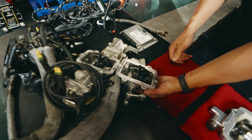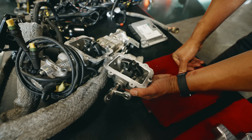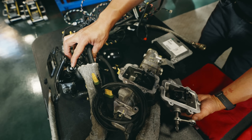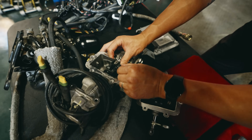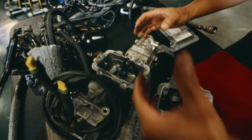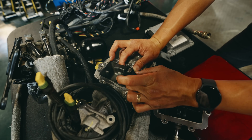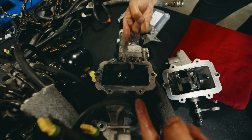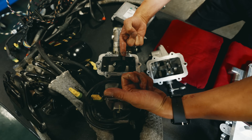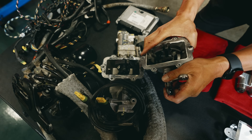So the F1 system — essentially same thing. Nothing inside the gearbox changes when you're doing a conversion from F1 to manual. What happens here is you have a bunch of solenoid valves that are controlling fluid flow. You have fluid flow that can change this. This one is a lot tougher to move, but it essentially pressurizes the system, balances the fluid, and goes up and down. What's easier to understand is not the selection but the engagement. You have two solenoids — when both are on, both pressures keep it centered. Then one turns off and the other keeps it on and slides this piece over.